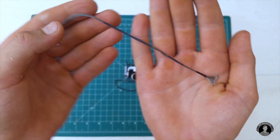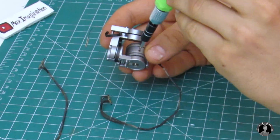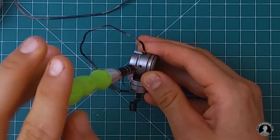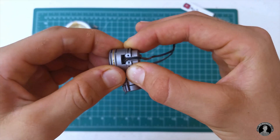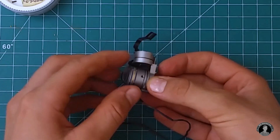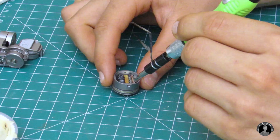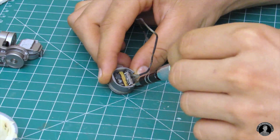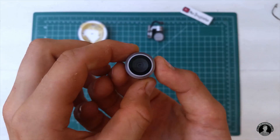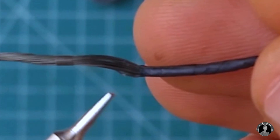Here is the video signal cable at its full length. To slide the camera off of its gimbal enclosure, you're going to need to unscrew the two screws on each side of the camera — careful not to lose them. With the screws out, it's still pretty tough sliding the camera off, but wedging the gap with a thin blade makes it slide right off. When it comes to unclipping the video signal cable from the camera, avoid using anything with a sharp pointed tip, but instead use something like a flat headed screwdriver. You can actually see the damage on the old video signal cable right here, where one of the strands got ripped.